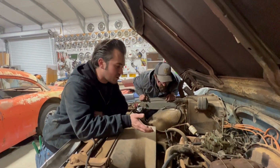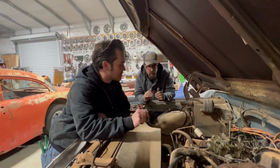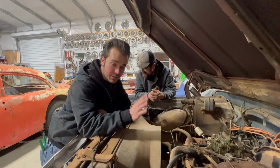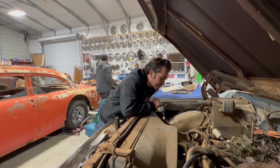See, you guys said you turned it over. We did. It's not, no, probably. So what's probably happened, there's probably a rust line in one of the cylinders. We just found it. Or the flywheel has a big old flat spot in it. Yeah. The teeth are ground down. That's probably what it is.